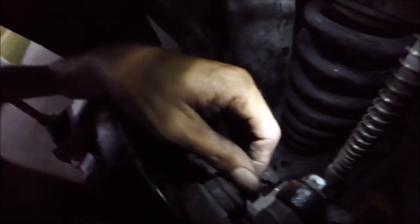After you get the piston collapsed, just put the new brake pads in the same way that you took the old ones out. There's only one way they slide into the little clips. It's getting pretty dark out so I have to hurry up. All you do is put in your two bolts to hold the caliper on, put this control arm or whatever back in place, and then put the bolt and nut through it to hold it — tighten it pretty tight.